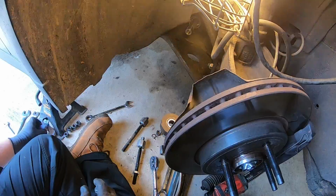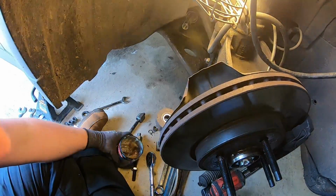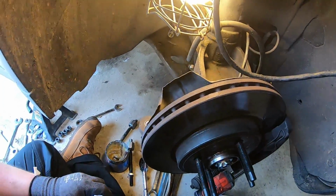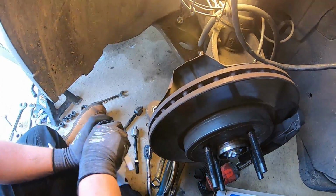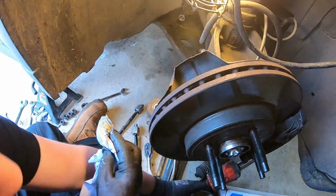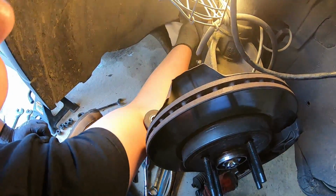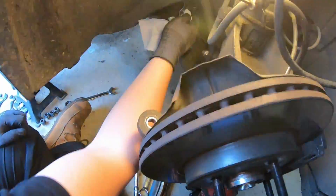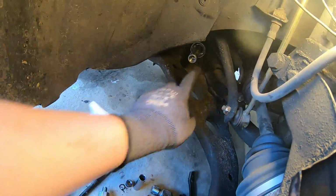And then, now I've done that, I want to get some grease. Have some sort of just normal grease by the way, like multi-purpose. Don't use copper grease. And then, yeah, get a bit of grease on there. Rub it down the steering rack again, mainly on the teeth that you can see. So there, that's all on there.